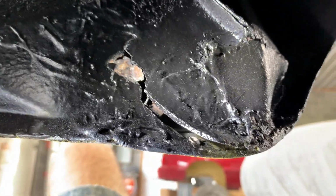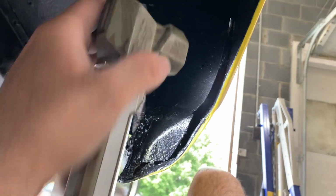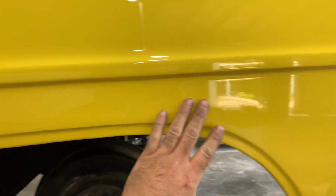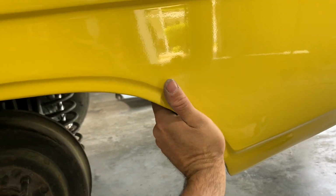but I don't know the situation. So kind of what I'm figuring on what I'm gonna do with this here is I'm gonna try and get this seam sealer out and cut it loose down here at the bottom, pinch weld, and see if I can't get this back wheel well corner to suck up to the inner fender well and bring that bow in. So I'm figuring if I take it loose down here and then pull it in, it'll pull this up here in also.